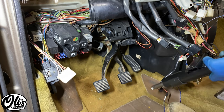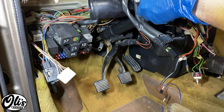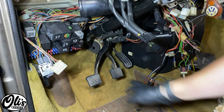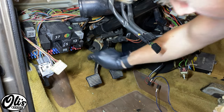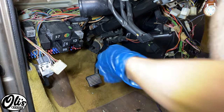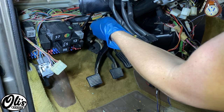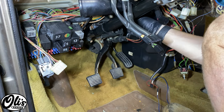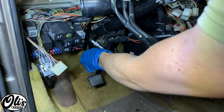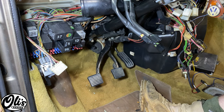I'm just going to take my steering column, slide it into this little area where the spring goes, and attach two screws just to hold it in place loosely. And now we get to wrestle with the spline shaft and the U-joint down here. Once you get it aligned just wiggle it in place — I did it off camera, it was challenging to film. Grab your bolt and put that through, and you might have to wiggle it just a little bit to get that cutout in the steering shaft to align. Attach the nut, then attach these two hex bolts — one goes right here and one's just on the opposite side. Torque this steering column bolt to 30 newton meters or 22 foot-pounds. Torque all of these hex bolts including this one right here to 87 inch-pounds or 10 newton meters.